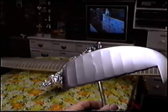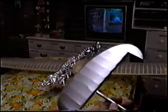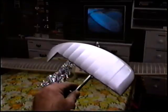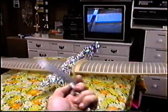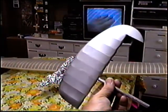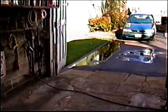Now our parts show no sign of fogging up, so hopefully I'm not going to have to add any retarder. I can just go with a straight 60-40 mix here. It's always good to have that dry before you go on to the mainframe, because once you do the mainframe, oh geez, always good to have little test parts. It's relatively cold and damp in here, and I don't know how good the spray footage is going to come out, but we're going to give it a shot.